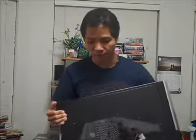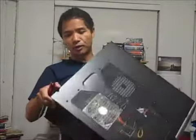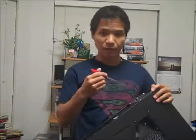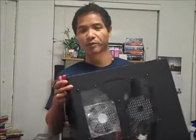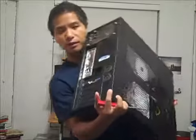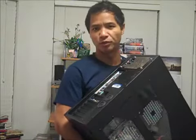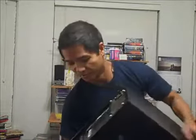Here is the tower for my Spartan computer. It's all unplugged, so I'm going to bring it over so I can start operating on it. What you need is a Phillips screwdriver to take out the screws that hold your side panel in place — the piece of metal that covers the side of your computer. You don't want to unscrew everything, just the ones that hold your side panel. In my case, it's this screw here and this screw here.